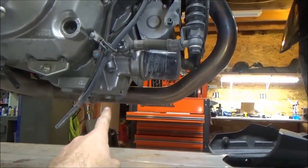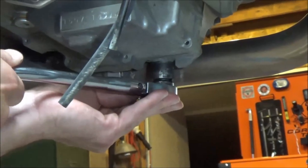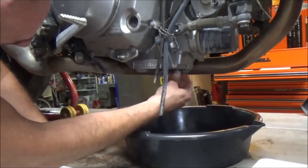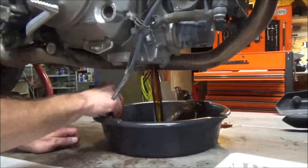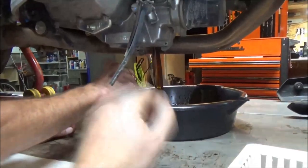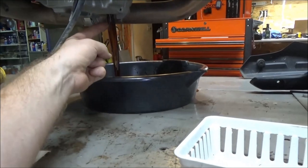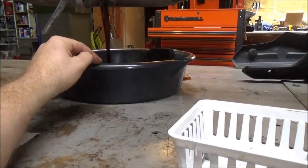They put it in a wonderful spot along with that drain plug. Before you go sticking your drain pan under here, go ahead and knock the bolt loose first, then remove it. Now we're going to go ahead and get our oil pan underneath there. See how easy it is when you start going upside down on stuff — it's really easy to strip things. Just the way that was hitting, it splashed out of the pan. Being prepared to move things around where you need it — there's no mandatory place for this oil pan. One thing to think about: as the flow finishes, it can start to come out of the pan, so try to have a good amount of pan all the way around.